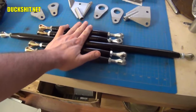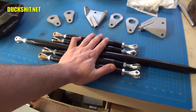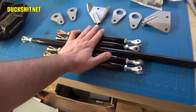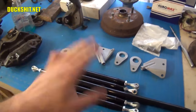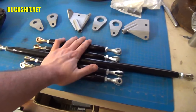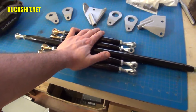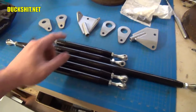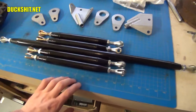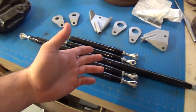This is something that probably should have come factory from Volkswagen. Some people might call it a strut brace, rear end brace, or in some cases a traction bar. What it does is tie together key points in the rear end of your Beetle to make everything stronger, tighter, and more rigid. In my case, if I have weakened those shock towers, this should strengthen that all up. I don't need a bar like this for performance reasons right now since I'm putting in a stock engine. This really comes into play when you start doing heavily spirited driving or drag racing — preventing wheel hop when the engine and transmission start flopping on those frame horns. Let's get outside and start working on this car.